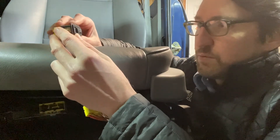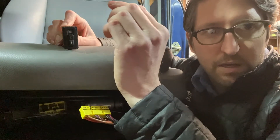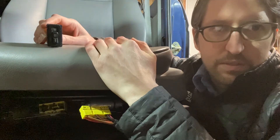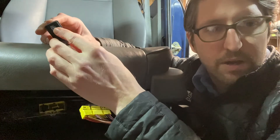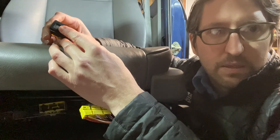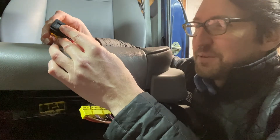What I did was have a 12-volt ignition source go to pin three, and then pins five and six trigger a relay in the engine bay. That relay is activated when you turn on your switch to high or low, and the relay then sends power to terminal 25 on the pigtail. I just like that — it's a lot safer. The switch does work if you have power going directly through it, but I prefer the safety of the relay. The way these switches work is when you turn them on high, they trigger the relay more frequently — lots of on/off cycles. On low, it's just a longer delay between cycles, and that's how it powers the seats. You can actually hear the relays in the engine bay click periodically if the engine's off, so choose a high-quality relay since it'll be activated a lot while the seat heaters are on.